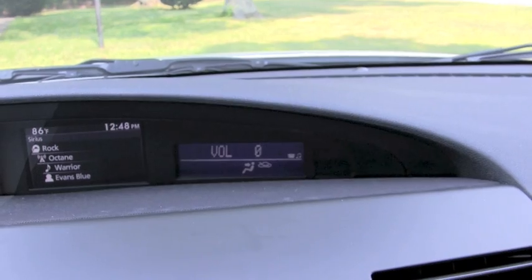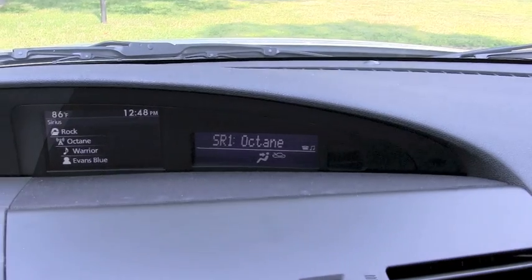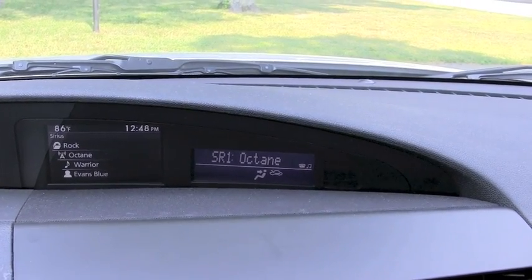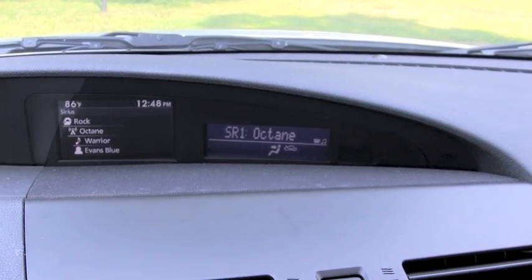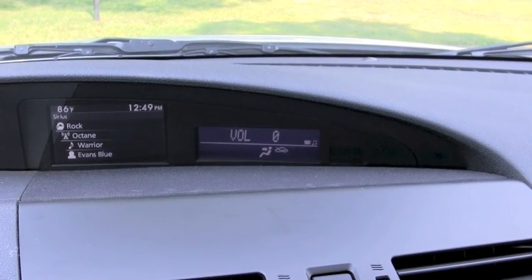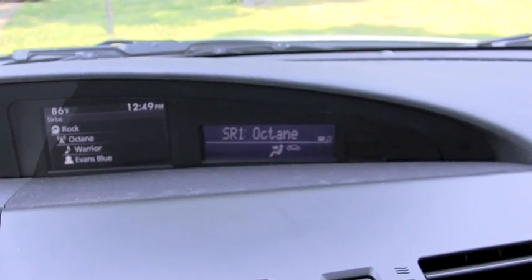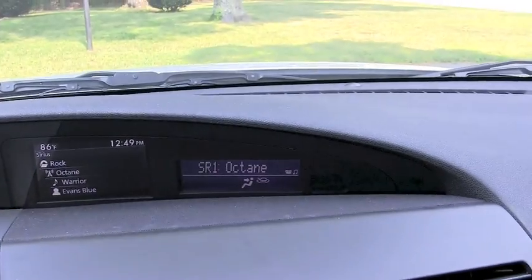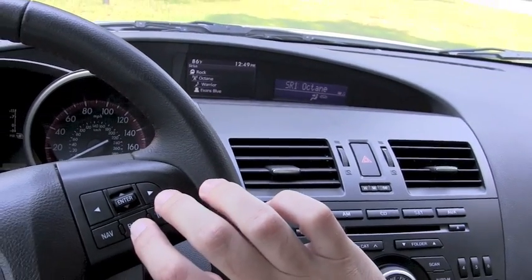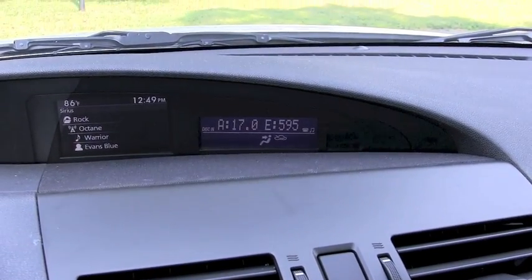You can actually turn off the CAN bus triple completely so it works in a bypass or pass-through mode — it will just display whatever should normally be displayed as though it wasn't even there. So if you need to take this into a dealership and hide it from them, they won't even know anything is there. To turn it back on, you just hold down the back button and push the right button, and you're back into this mode again.